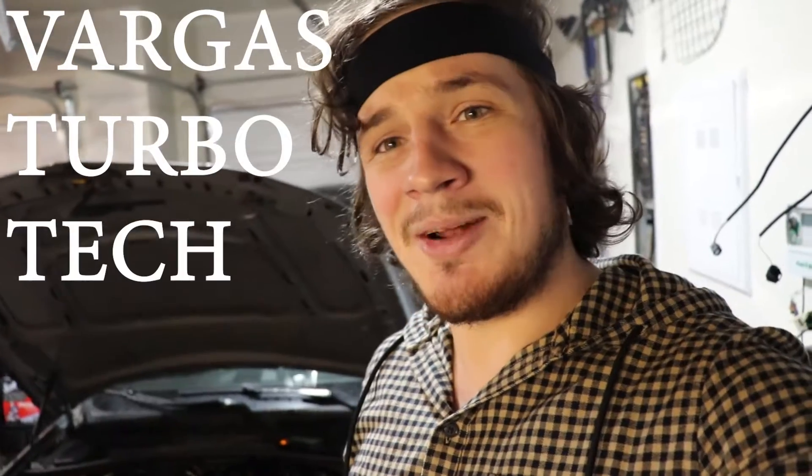Why did I pick the VTT crank hub of all things? VTT doesn't necessarily have the best reputation — a lot of my friends like to use the acronym 'very terrible turbos.' Nonetheless, I think it is really hard to mess up a piece like this. The pinned crank hubs are significantly more expensive and kind of obnoxious to install; they have to be drilled into the crank perfectly, and I've heard of too many incidents where things did not go right. FCP Euro recommends it, and I do love FCP Euro. Keep in mind this is for the N54, but it is very similar to the N55 and S55 installation — slight differences you can find in the VTT instructions, linked in the description. This video is to give a general idea of how this goes, since there's no other video on YouTube at this time of installing this VTT crank hub.